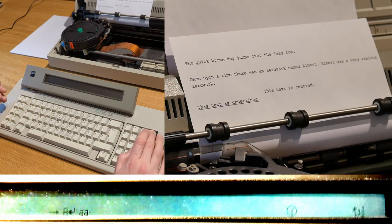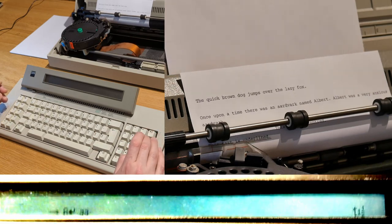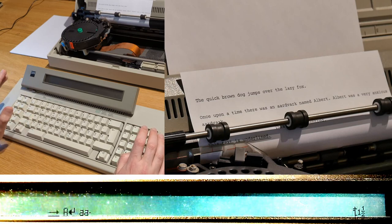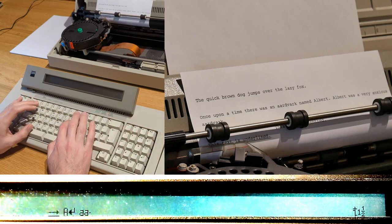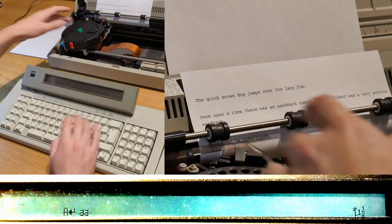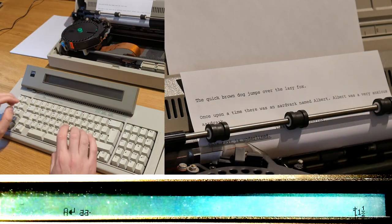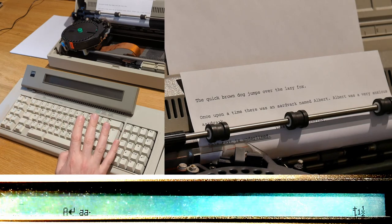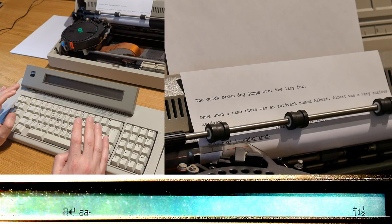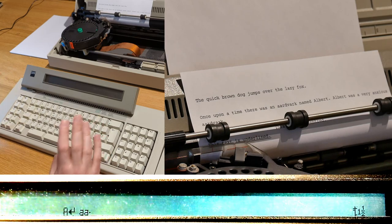Which works as you would expect. The weird thing is that it does the underline by printing a letter and then backspacing and printing the underline, which is not what I'd expect. The print head is actually drawing bitmaps, which are stored in the ROM cartridges. So there's no reason at all why it couldn't just assemble the data in memory and print it all in one go, which would actually be faster.